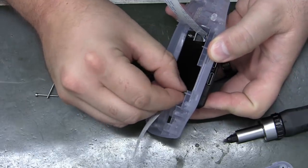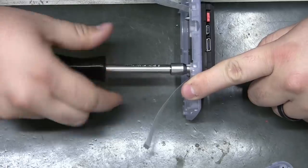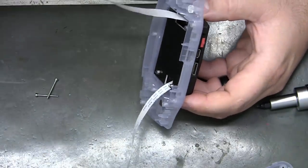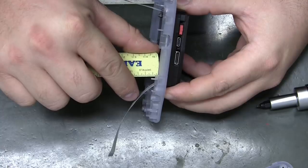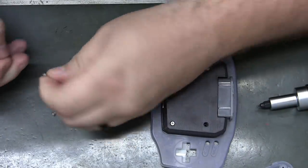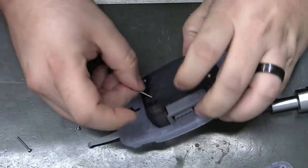Moving to these is what we want to do. It just simplifies shipping. That way I'm not looking for a whole different bolt just for the LCD kits. So Woozle talking about making this piece thicker to accommodate these 20 millimeters, and I'd say for sure could make it at least 1 millimeter thicker, if not 2. And I think it just comes down to the head of that bolt just being different enough. You look at the head of the thing, you think, oh, that's definitely going to stick out more, but for some reason it doesn't. Okay, so the OD of the head is smaller. That must be why.